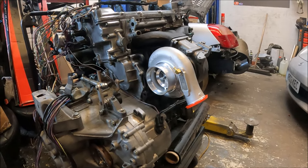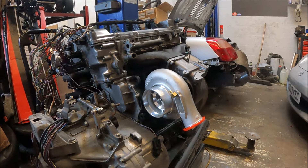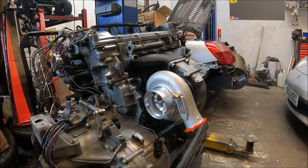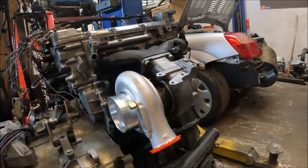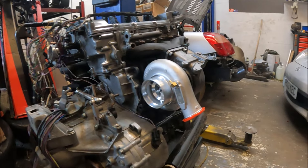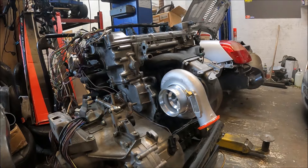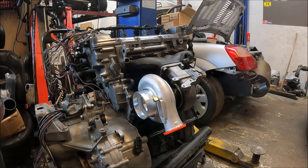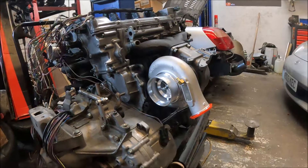The HX35s they used to run up to about 600 horsepower proven, even with tiny aftermarket bolt-on housings that allowed it to fit the standard exhaust manifolds. Because the flanges were a funny square type, they called them BP flanges — made by Bullseye — and they were tiny turbine housings, like 0.55 AR or something. They would push them to 600 anyway. They also used to push the HY35s — which have basically the same compressor but a smaller turbine wheel around 60/58 — to 600 as well, and that'd be with a 9cm housing. So an 8cm on one of these is not an issue.